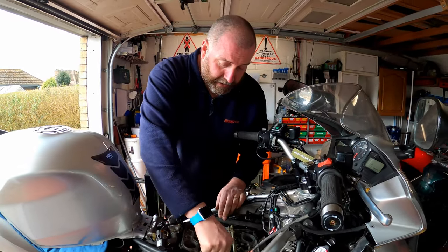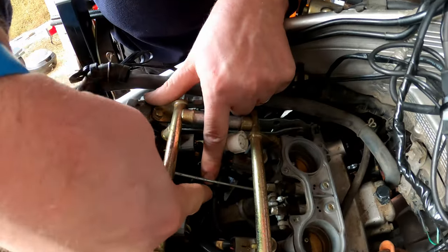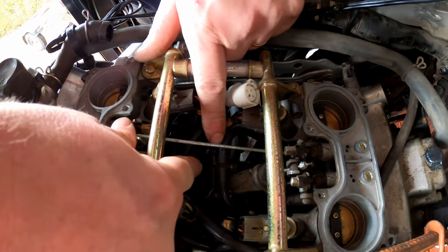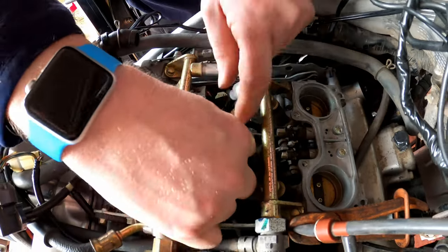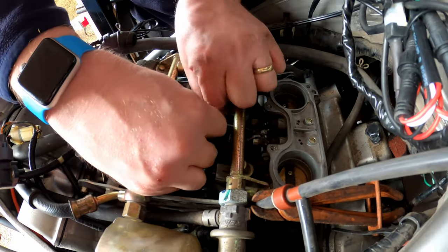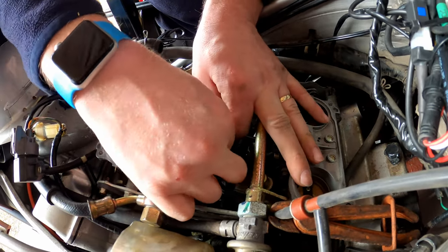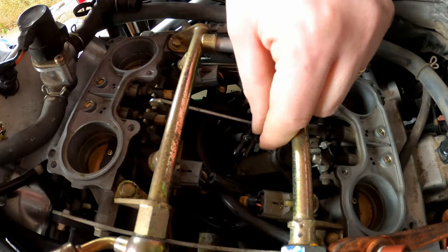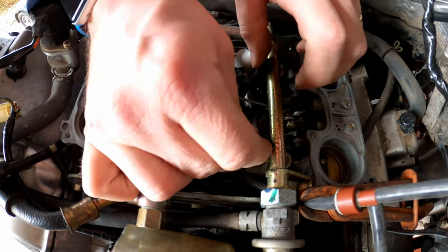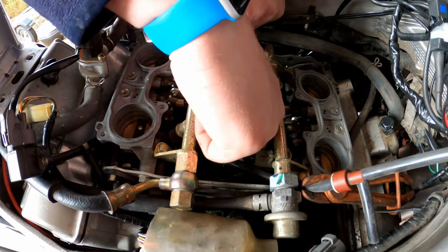What we need to do is connect a manometer up to each of the starter valves. Just in here right in the centre you can see this little plastic connector — there are five T-pieces off of it, one in the centre and then one that goes to each of the starter valves. We need to pull the vacuum lines off of each one, just like that, and we're left with those. Each of these is what we're going to connect our manometer to.